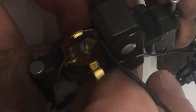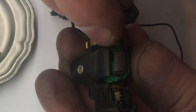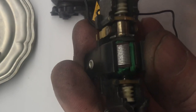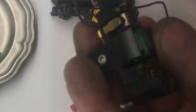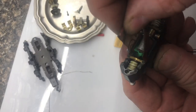Do the same thing to the other side with the other brush. If you take a look at this brass wire, it's got a little hook that connects to the fiberboard, and that allows you to fight against the fiberboard to make strong contact with the brush. Before you hook it up to the battery, we need to make sure that the commutator is very clean. These little grooves — if anything is in here, it's going to give us problems because it'll connect the power where it's not supposed to be. So take a needle and clean those out, feel for any debris. To help remove corrosion, I put some sandpaper through here and just scrub it out — you can see I can pull the paper all the way through.